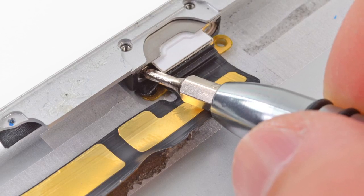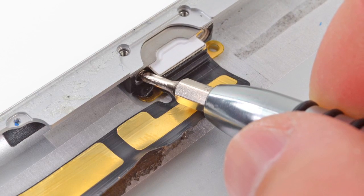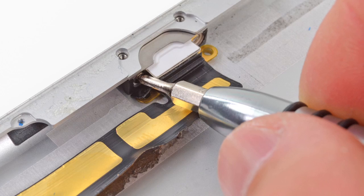So it'll be interesting to see if it lives up to the 10-hour battery life promised by Apple. Along with the iPad 4, the iPad Mini is the first in the line to get the lightning connector, and we were very curious to get it out and have a look at it. Unfortunately, once we removed the screws holding it in place, we discovered that it was soldered to the logic board, which is super disappointing. Connector replacement is one of the most common repairs we see in iOS devices, so let's hope this new connector is significantly sturdier than the original 30-pin version, because replacing it in the iPad Mini requires an entire logic board replacement.